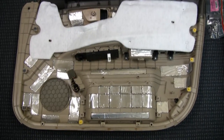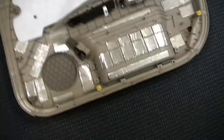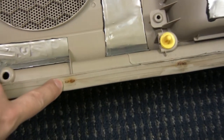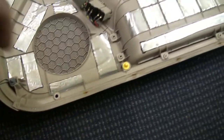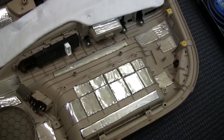My components are ordered and taking a little while to get here. While I've had this apart, I've noticed some factory flaws I'm going to fix. There are staples stapling this trim on, and they're rusting like crazy — actually starting to corrode the metal on the door. The car is only two years old. I'm pulling these staples out and stitching the trim on through the holes with 50-pound-test Spider Wire fishing line. That way I never have to pull them off again and don't have to worry about the doors rusting.